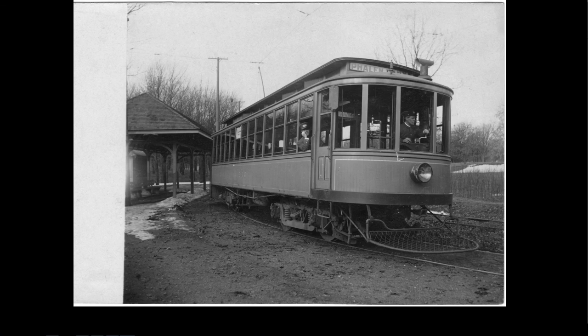Until 1902 these cars were all built with hand brakes — a big gooseneck rod that the motorman would lean into, requiring real planning ahead because they did not stop on a dime. After that they went to air brakes, with a cylinder under the car. You'll hear the compressor pounding under the car, and air brakes had tremendously more stopping power than hand brakes. They also gradually pared excess weight off so later cars weighed a few thousand pounds less, lowering energy consumption.